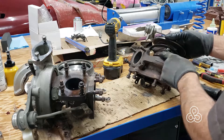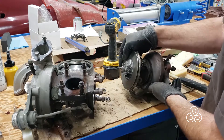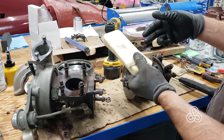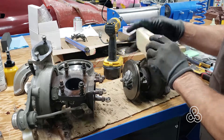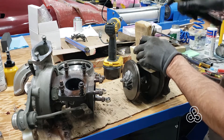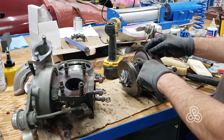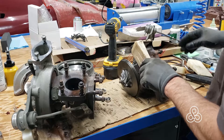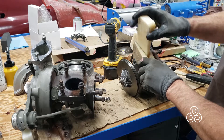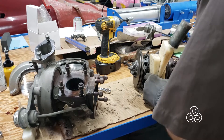This section is where it really hangs up because of all the carbon buildup from exhaust traveling around the turbine wheel. No amount of power alone is going to break it free — you need a little gap. I have these nice nylon wedges; wood wedges would work too. Put two wedges between the casings to create a small gap, then slide a third wedge in. Be careful not to bend the bolts through there when driving them apart.